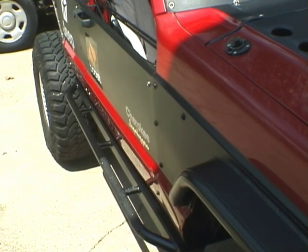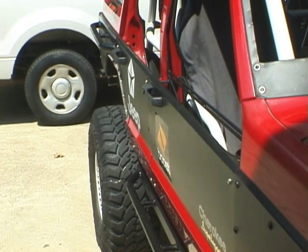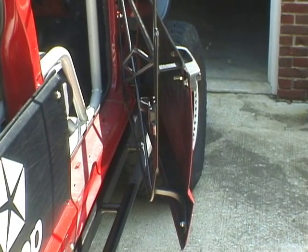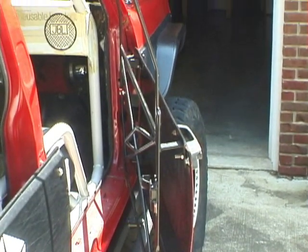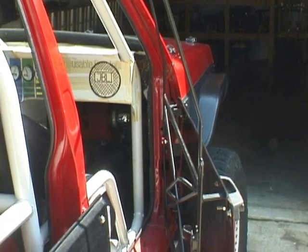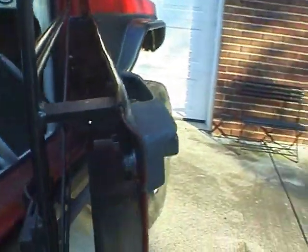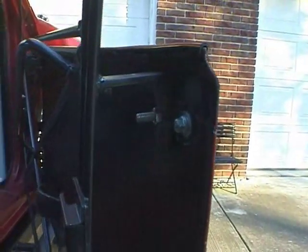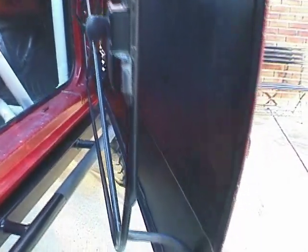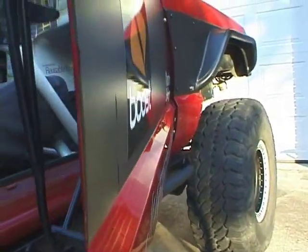Moving on to the door skins — they have been gutted. There's no glass in the vehicle anymore; the door skins are now just very thin sheet metal. We used a 5/16 round bar to make an interior door that actually fits very snug in there. I have a vinyl window made from a BMW convertible top that fits on top of that. The handles are just for looks, except for the one on the left, which is an actual crane-type door handle to get in and out — it locks up and keeps it real nice and snug.